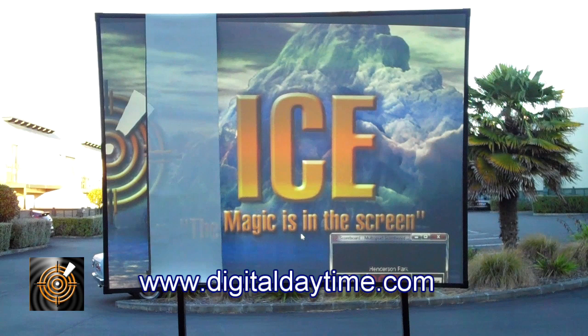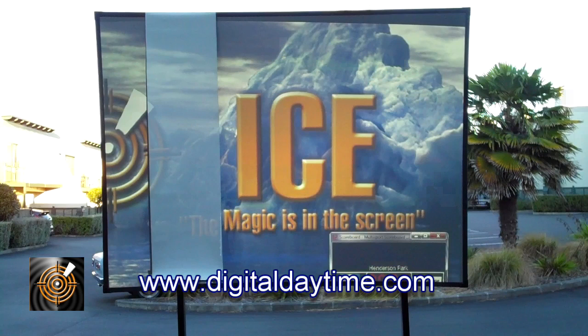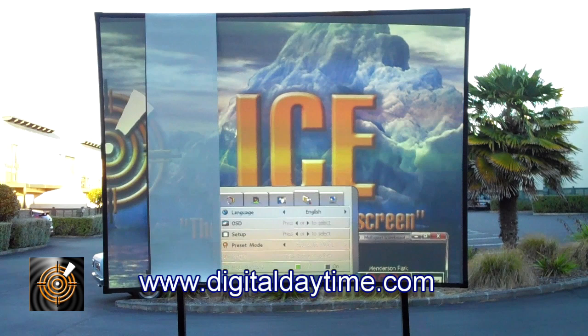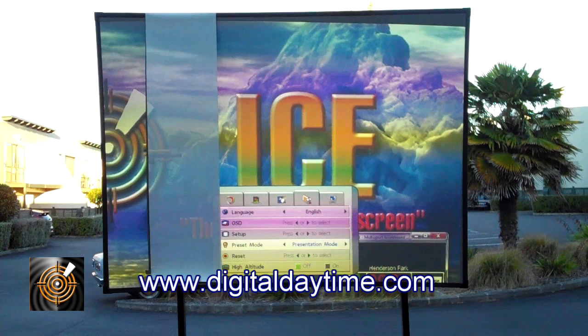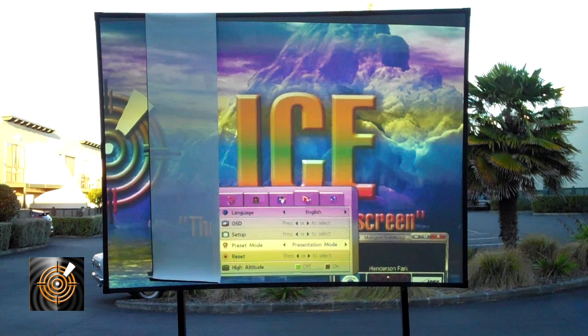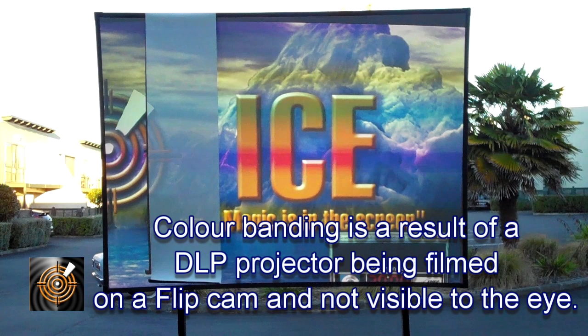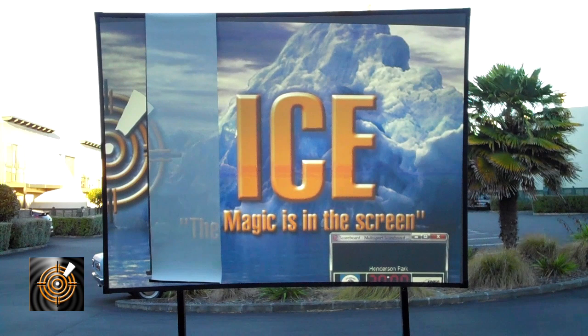It's that banding over the white screen coming over the front that I really want you to understand. I've just noticed that I had this projector in economy mode — we're now going to put it into presentation mode. You could see that, certainly to our eyes here, the actual brightness increased. You're probably still seeing some color banding on the screen, but the important thing is the matte white screen hanging over the side surface is actually extremely poor — probably only reflecting about 10% of the projector light back to the viewer.